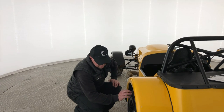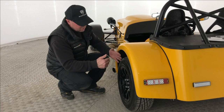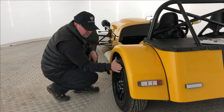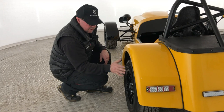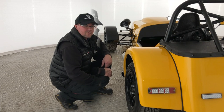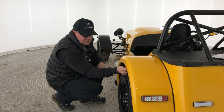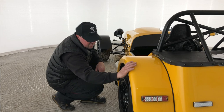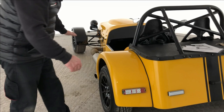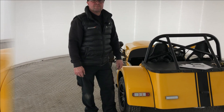Same as the front tyres, making sure the outside face is correct and there'll probably be a matching pair or staggered sizes like 205s and 185s. Also making sure, at the same 30-degree angle as the front test, it covers the tyre, and that pulling a straight edge down, the tyre does not protrude outside the rear arch — which this one doesn't. If you had a wheel offset and the tyre was out here, that would be a foul. Making sure the compliance is there with 30-degree coverage. Any aftermarket arches must also pass the 2.5mm radius test all the way around, under the rear of the panel and along the floor line area.